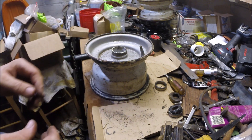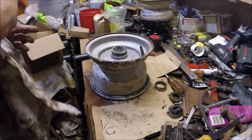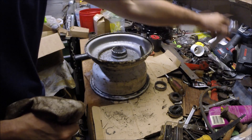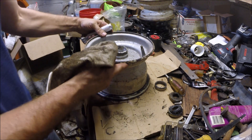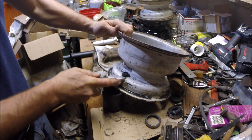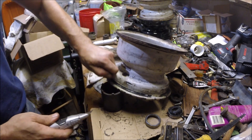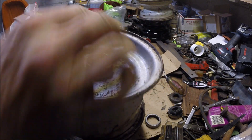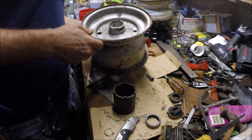The new bearings and races are supposed to come today — this is a Sunday. I'm not big on Sunday delivery, but I guess it works out for me. When those come in, I'll show how to drive those in with this bearing and race driver tool. For the stem, you just get a knife from the back side and cut through it. Once you're past it, they pull out really easily from this side. Clean it up real good, pull the new one in from the back with some silicone-based lubrication, and the stem is good to go.